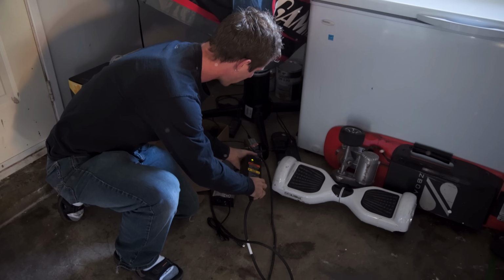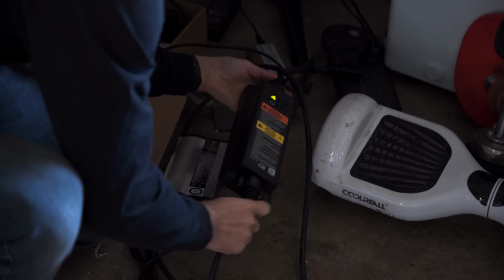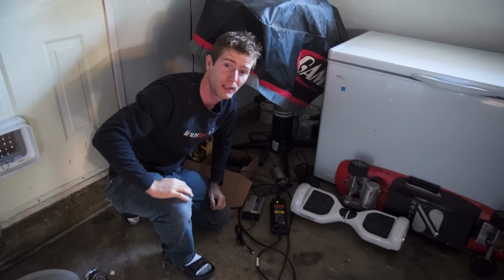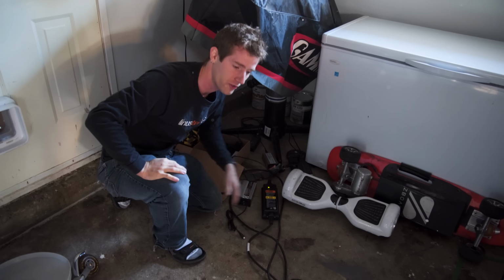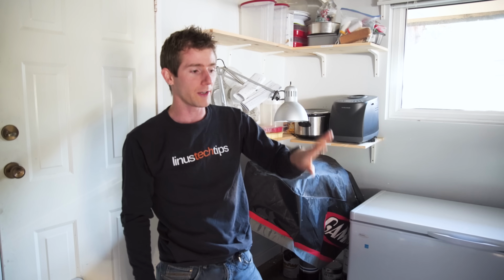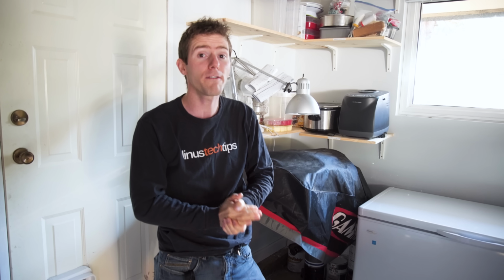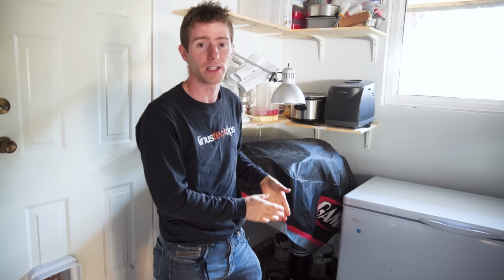So this is the wall charger that's included with the Volt. It runs at 120 volt and it charges at, I think, a maximum of about 1400 watts, which quite frankly is lots for a plug-in hybrid. If I had this running at full capacity, I could easily charge it up overnight. But as some of you might remember from the video where I talked about getting this car, my intent is to do car reviews on an ongoing basis moving forward. So if I were charging up an actual full electric car, this would be painfully slow.